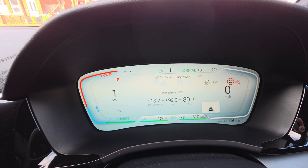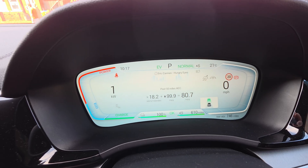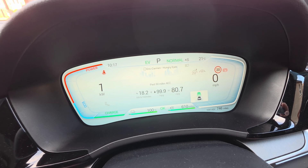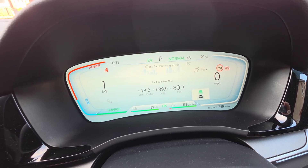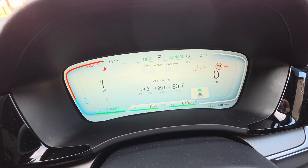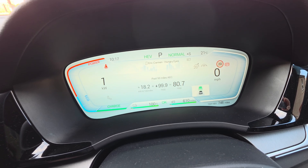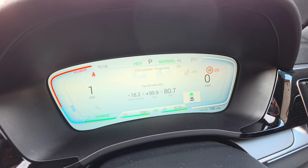Here's the other caveat: when you're on 100% battery, every time you start the car it will start in EV mode. I don't particularly like that because it's a pretty chunky car to run around in just EV mode — I'd rather have the engine assist there all the time. So up until the car reaches 70%, I'll put it in HEV mode each time I get in. Once the battery drops to 70% it will stay in HEV mode. Remember, whenever you recharge back up to 100%, it will always start in EV mode — it's up to you whether you put it back in HEV or stay in EV, but personally I prefer HEV.